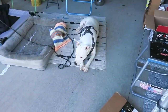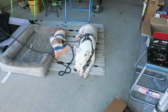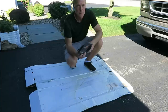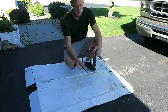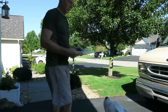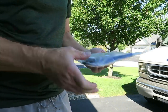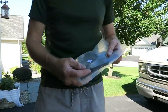Just came back from our morning walk — Lefty just had his breakfast, some kibble with hot water and a bunch of chicken thigh mixed in. Spoiled. The airline that comes with this kit is a rigid hard plastic quarter-inch OD. These are the threaded ends and the Schrader valves. The instructions really emphasize using a fresh razor blade to get a clean square cut — don't use side cutters, don't use a pipe cutter. Got a nice clean cut. Let's get up under there and do the heat shield first.